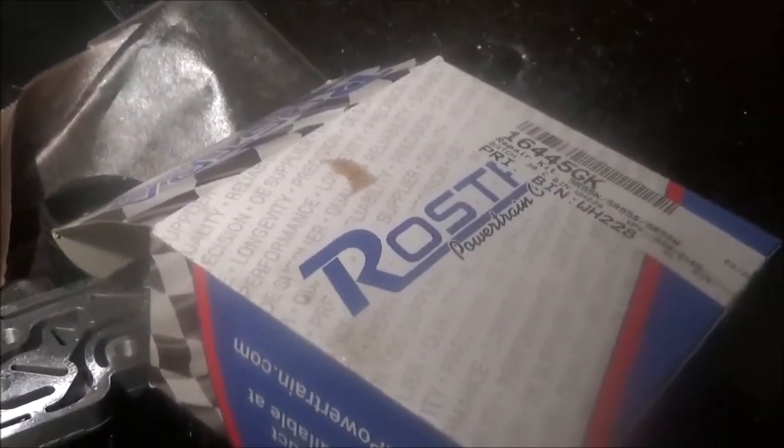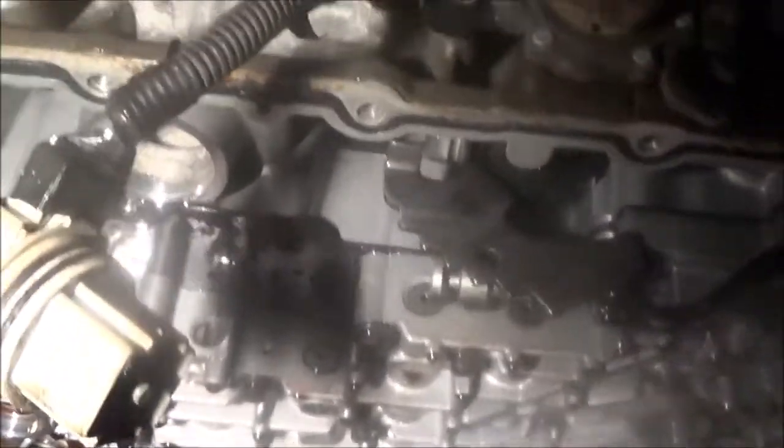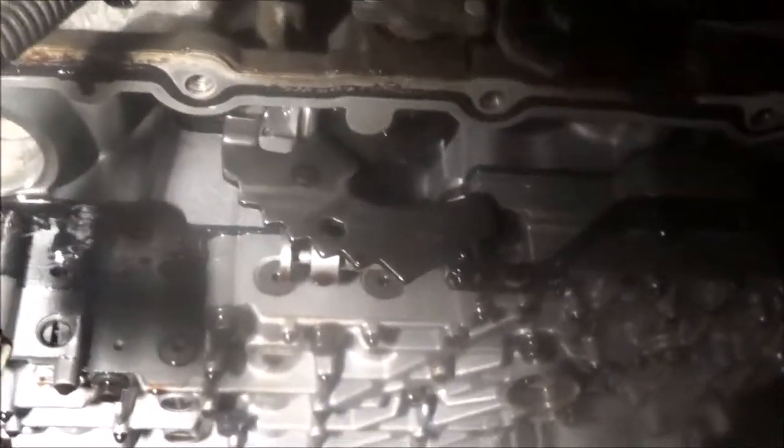So my recommendation is you do this one by one. Take each wire loose and put it together one by one, because if you cross the wires, then you're going to have another problem, and you're going to have to try to figure out what wire you crossed, because it still won't shift right. So you cut one wire at a time. Before, testing is what led me to this. Now experience takes me straight to it.